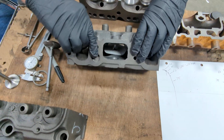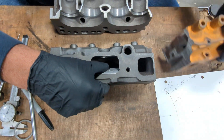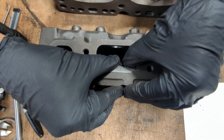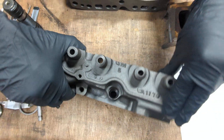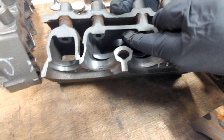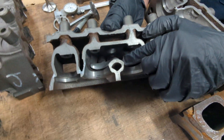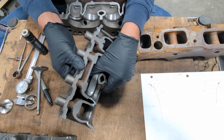So this is the fix. You can see this port — we've chopped out the bolt boss. The bolt boss is right here; we've taken it out. We've made this bolt-in lump. The bolt-in lump sits in here and it creates a false floor to the port which is elevated. It raises the short-turn radius, so the air is now flowing higher in the port. It follows the top of the port and goes all the way along the back — it doesn't slam into it, it follows it. This bolt-in lump increases your flow by 10% over the standard port because of the short-turn radius.